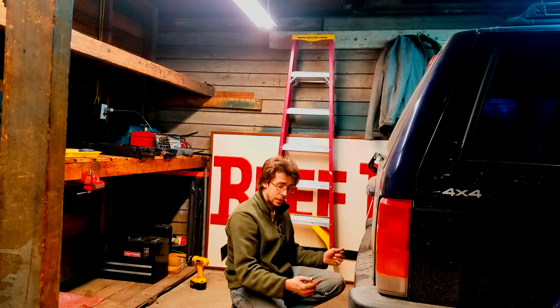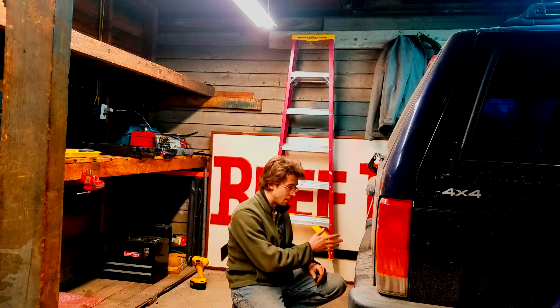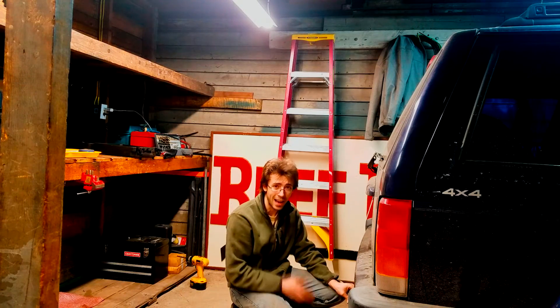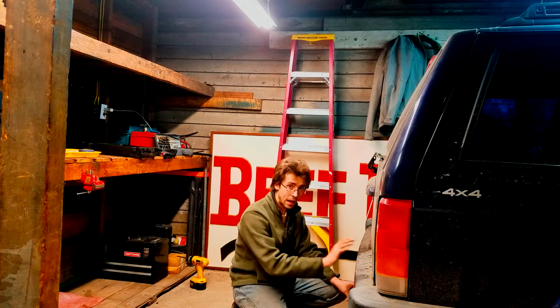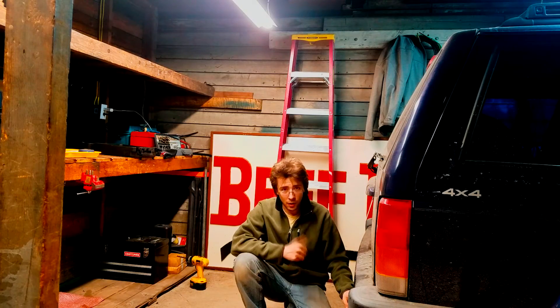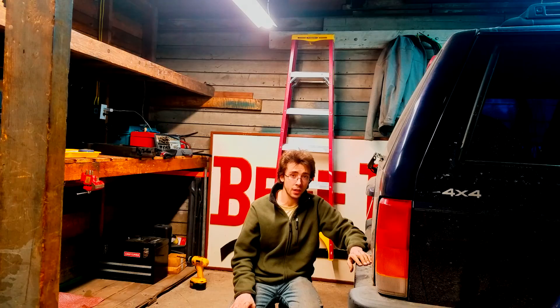Lastly, there's a little lip where the unibody of the vehicle comes down — hit that with a hammer just to start it moving out a little bit. You don't have to flatten it out all the way, but as you saw on my driver's side it sucked up real nice, whereas on the passenger side it's not on very good. Don't buy this, guys. If you're going to be using it on multiple vehicles, go ahead. But if you're using it on your Jeep Cherokee like I am, don't do it. Have a buddy, pay attention to the instructions, and buy the right hitch. I'm going to be getting the wiring harness tomorrow — that should be a very easy install compared to this. This took me hours when it should have taken about an hour. Catch you later.